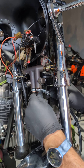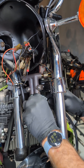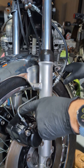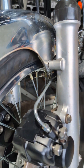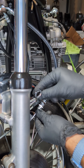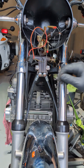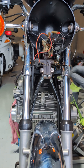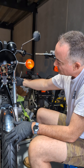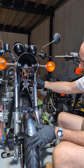This will all get nipped up before we run fluid into it. Same thing on the other side — the back of the brake line has a hard fitting, sandwich the copper washers between the fitting, and the curved back of the brake line goes into the notch on the back of the splitter. Fairly common sense, but worth pointing out because occasionally we see bikes where people don't use that approach and things don't end up going well. So that's finger tight all the way around. There should be clearance between the full extension and the hard brake line — it should be a gentle curve with no binding or kinking from the splitter down to the caliper. That's your electrical connection for the brakes — no particular polarity, as long as you've got your blue and brown connected for the front brake indicator.